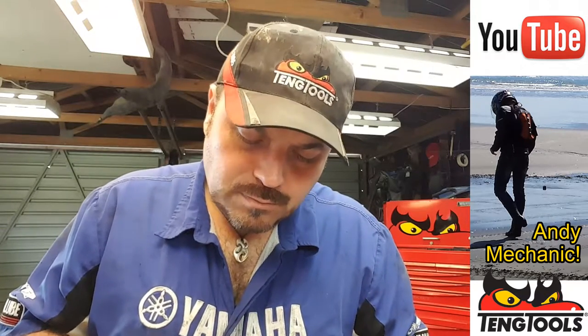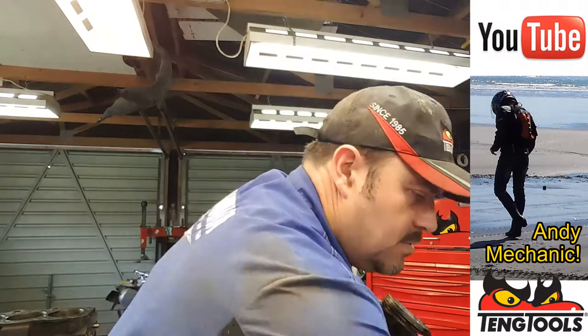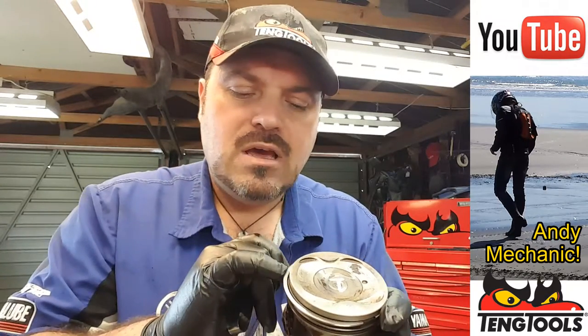There was a lot of carbon on this engine, which was obviously a bit of an issue because it was burning lots of oil. Now I've put the rings back on again — it's important that you remember which is the top ring and which is the middle ring because they are different. Those are now refitted, so we can use some feeler gauges to measure the gap, or the additional clearance, between the piston ring and the piston itself. I'll put it in the vise with a rag so you can get a nice clear view of what's going on.